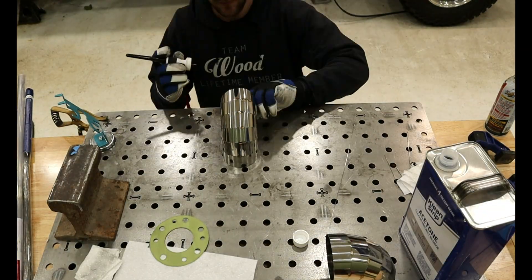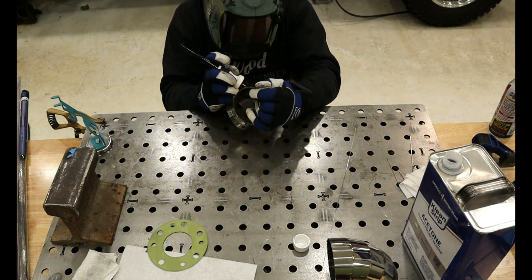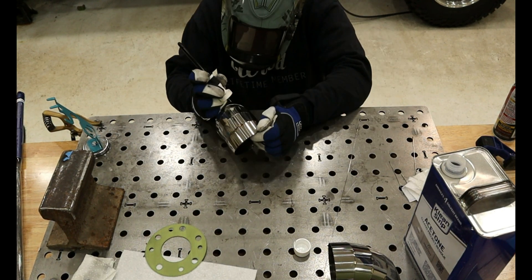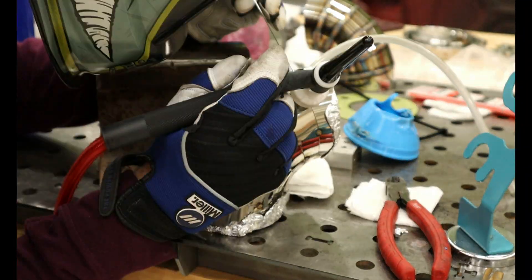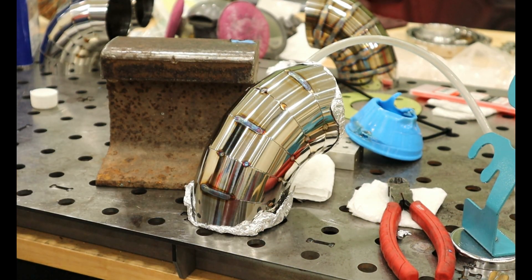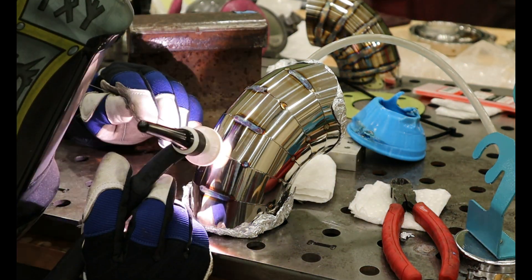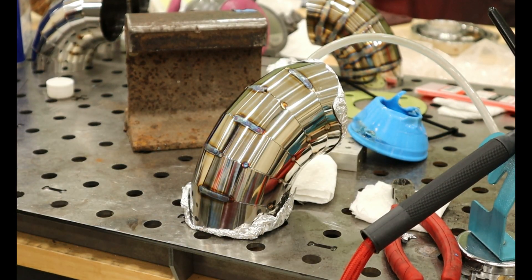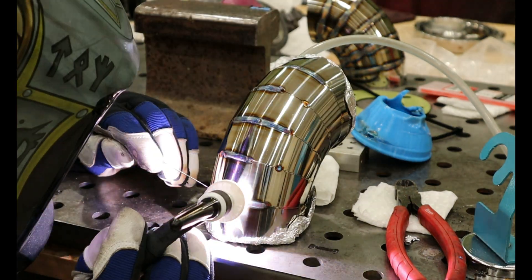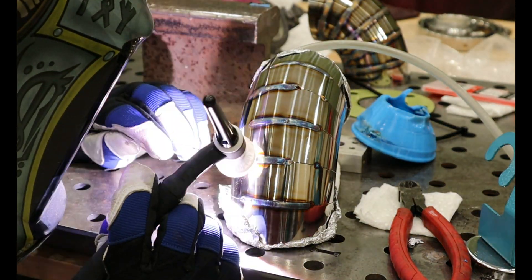While you watch me weld up these 90 degree joints, here are some tips I found while I was waiting on my new parts to show up. Don't fabricate in one shot — do a few pieces at a time so you can adjust for warpage and misfit. Use the proper size filler: I used 0.035 wire, which melted much better than the 1/16th inch I used earlier, resulting in the filler sticking to the base metal. Use pulse settings if your machine has it — this is to reduce overall heat input. I started at 2 Hz, ramped up to 4 Hz, and finished at 200 Hz. Let your part cool down between welds — again, this is to reduce overall heat input, reduce warpage, and help you achieve those awesome colors stainless is known for. Add a tack every 1 inch to reduce warpage when welding; it also gives you a signal to stop welding at each tack and let the part cool down. Lastly, make sure you have appropriate gas coverage — this protects your welds and should help achieve beautiful colored welds. I was using pre and post flow along with a number 16 cup.